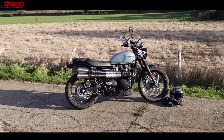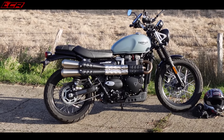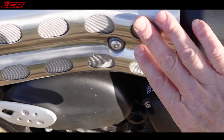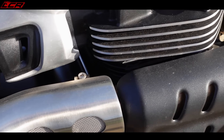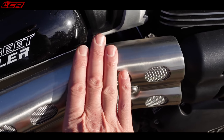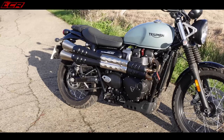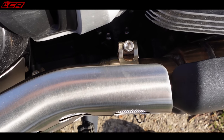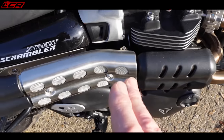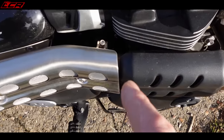So there she is, the 2021 — and potentially 2022 as well — Triumph Street Scrambler. Let's have a closer look. First thing to mention is this exhaust — you can see all of the heat cladding on it. When you're sitting on it, your legs are sort of touching between here and here, which is a bit warmer. Touching it now, that is actually quite hot. But my leg was really resting on this piece here and I can touch that with my hand — there's a little bit of warmth in it, but it's not too hot. So in the summer I think you're going to get a little bit of heat from that exhaust. Doesn't it look beautiful? I've heard some people say for Euro 5 you can't change the end cans, but here halfway down the pipe we have a joint, so you should be able to change that. You'd have to change the exhaust from there back though — you can't just change the end cans, you have to change this whole section.